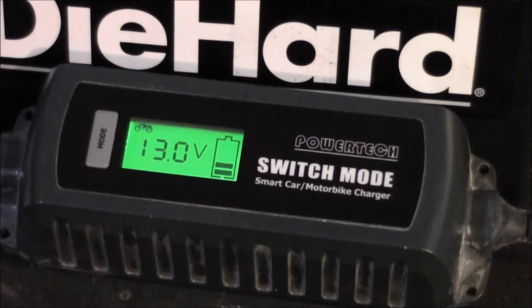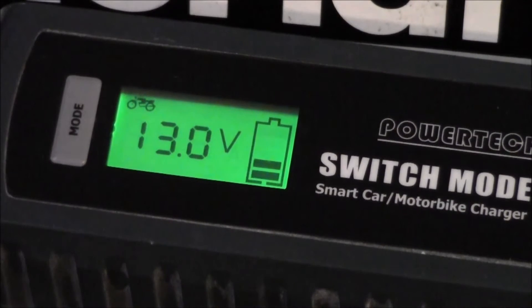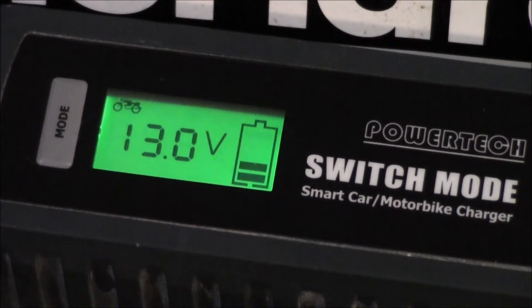The 3.8 amps is pretty powerful too — you're almost getting four amps, so this charger is pretty handy in the shop during the day. I can charge a battery up decently quickly. Probably the best thing about it is definitely this display — especially for someone who's more of a novice when it comes to charging batteries. Everyone can understand a picture of a battery with little marks to know whether it's full or empty. Probably the only real drawback is how much it likes to spark when you hook it up, but you pretty much have to be careful about that with any battery charger.